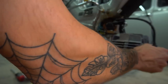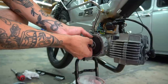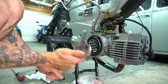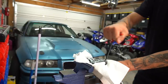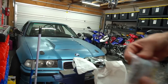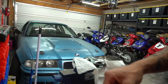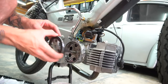I got a bag of clutch springs for the Pook right here. To change them we have to drain all the oil out, pull the kicker cover case off, pull the clutch out, and go from there. I'm going to go back to the stock springs that come with this clutch to really see the difference. Time to put it all back together.